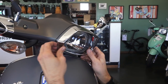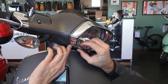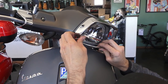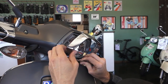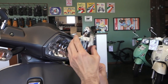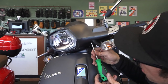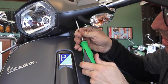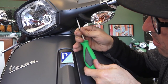Once the pair of small screws are removed, the headlight bezel pulls out towards the bottom and un-snaps from the top. Carefully remove the bottom part — the clips tend to want to stay behind. These clips that the screws thread into are commonly referred to as Tinnerman clips. Four screws hold the upper handlebar cover to the lower handlebar — again, a number two Phillips driver will do the trick.